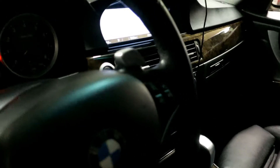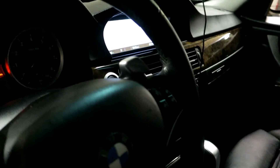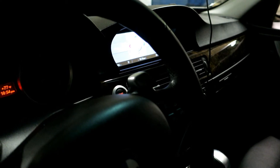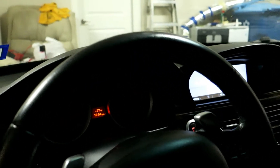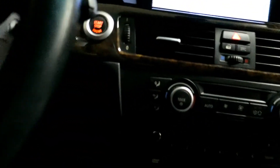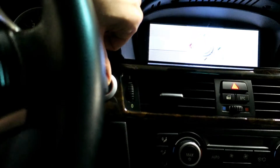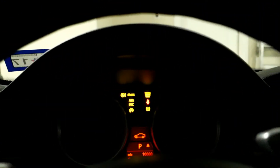Whenever you're coding, the first thing you want to do is make sure you have a good battery, and if you doubt the condition of the battery just connect it to a battery charger. Mine's in good shape — I changed it recently. If you don't have comfort access you have to insert your key, but I have comfort access so I'll press it once and press it a second time so my lights light up on the dash. Turn off your headlights and your interior fans so you don't run down your battery.